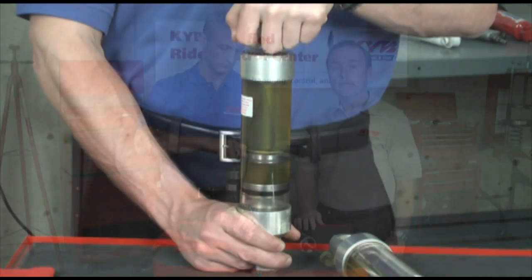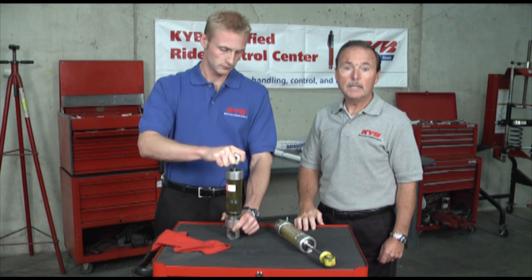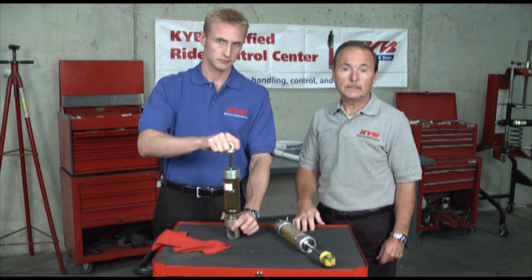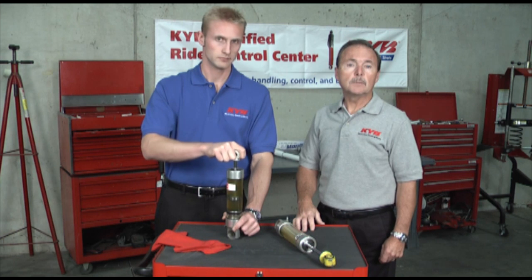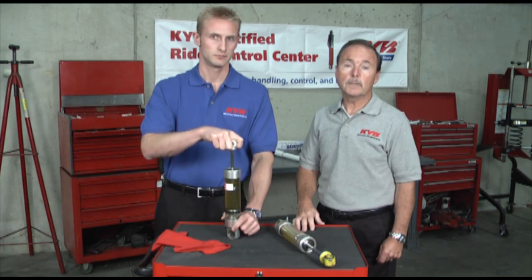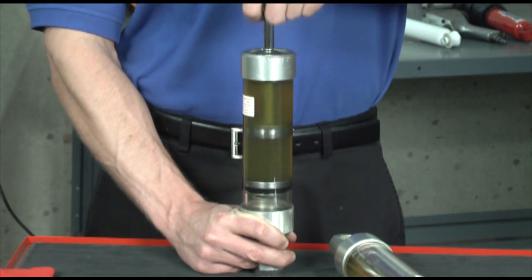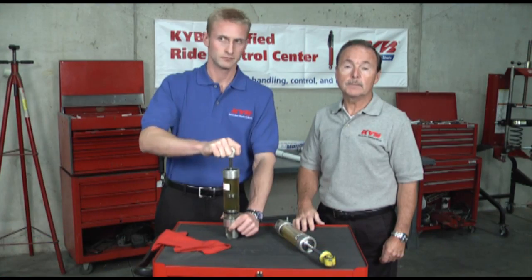During vehicle movement, not all of the fluid can pass through the valving. This puts pressure against the floating piston and the nitrogen gas chamber. On lighter movements, it has a cushioning effect, but on more aggressive vehicle movements, the gas pressure increases quickly and offers additional resistance. This gives the monotube variable performance based on driving conditions — higher performance just when needed. You can also see that no matter how aggressively Aaron pushes and pulls, there's never going to be any aeration. The monotube fluid-only valving guarantees that, so the vehicle will never have any performance fade conditions.